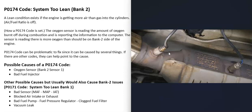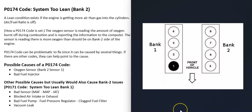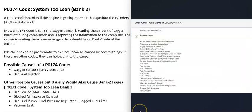When you have a V6 or V8 engine, the engine has two banks. Bank 1 is always the side of the engine with the number one cylinder, and the opposite side is always Bank 2. If you Google your engine's cylinder location or firing order and locate the number one cylinder, that side is Bank 1 and the opposite is Bank 2 — though there are differences between engines.